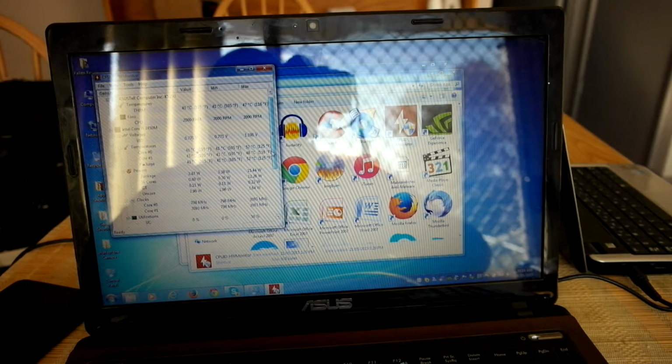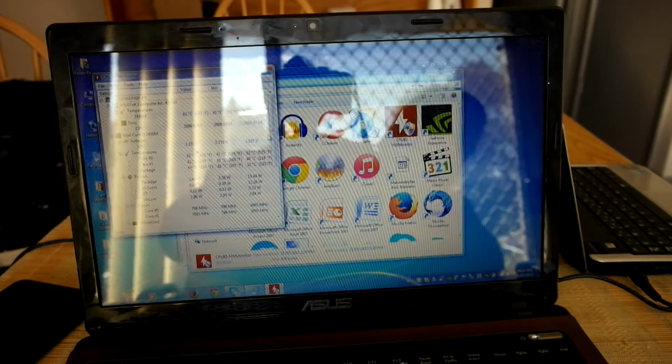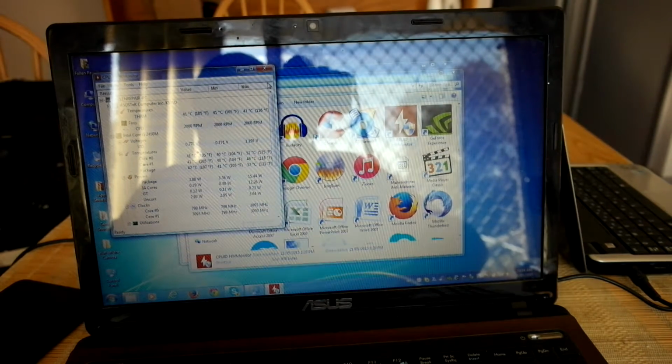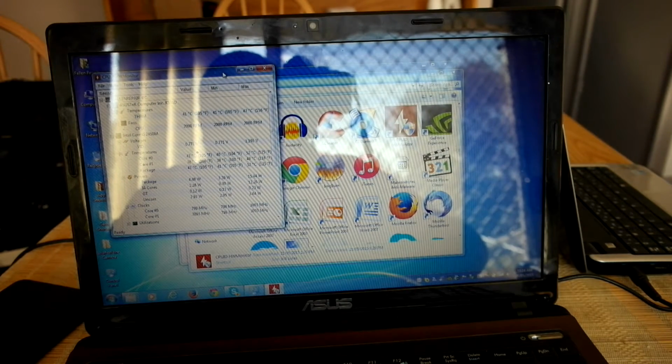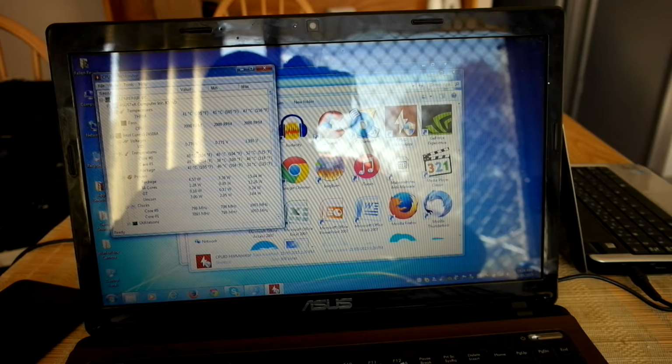So I blew the dust out of it. I basically took the back off the system, took some screws out, and took some other parts out, like the CD-ROM drive, I think. I pulled the CD-ROM drive out as well as a couple of other bits and pieces, took some stuff out of the system that needed to be taken out, and blew the system out. As I could tell, there was a fair bit of dust in the actual heatsink itself, which does happen.